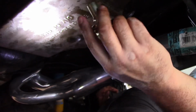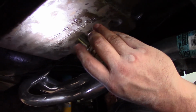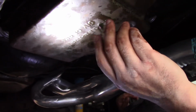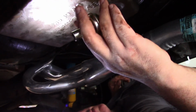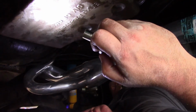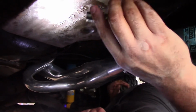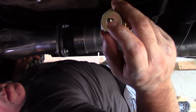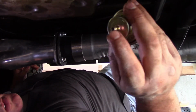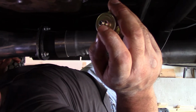The other modulator valve you saw, it was massive. But this is what I found when I looked it up, this is the Turbo 400. So maybe they just downsized it for exhaust or something, I don't know. But today, when you pick one up, it's only that big. And like I said, this one is adjustable on the end, but I'm not going to adjust anything until I drive it down the road. It might be perfect, so we're going to leave it alone.